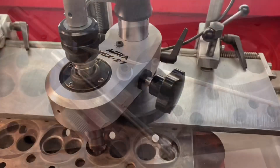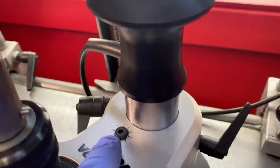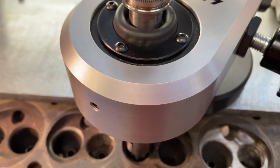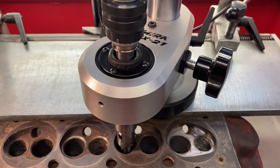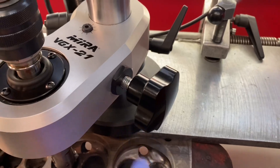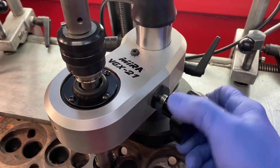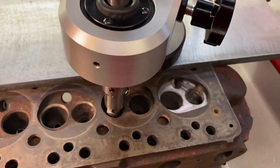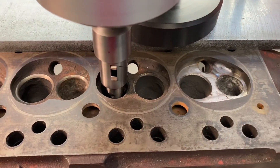Let's go ahead and cut the seat. With the magnet in place, the cutter is suspended above the seat with this height control ring, and there's an adjustment screw so you can make sure the cutter is not touching the seat when you set it. You need to have a pilot that's quite accurate — that's really the guide to make the system work. There's the magnetic base locking arm and hydraulic lock for the main spindle to hold everything in place. This is the depth ring which drops the cutter down onto the existing seat.